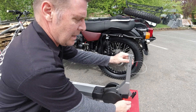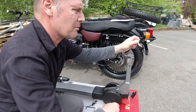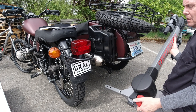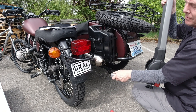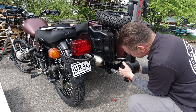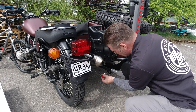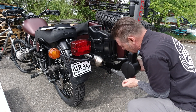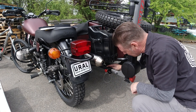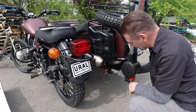This is the wedge that you tighten up on the knob that will help secure it into the receiver, as well as a quick release pin. You're going to want to loosen the knob so there's enough slack for this to sit down. Slip it into your receiver, push it in, and line up the hole. This little pin is going to only go in from the left side when you're standing behind the unit — the other side has got that threaded rod running through it for the wedge portion of the mechanism, so you can't put it in from the right hand side.